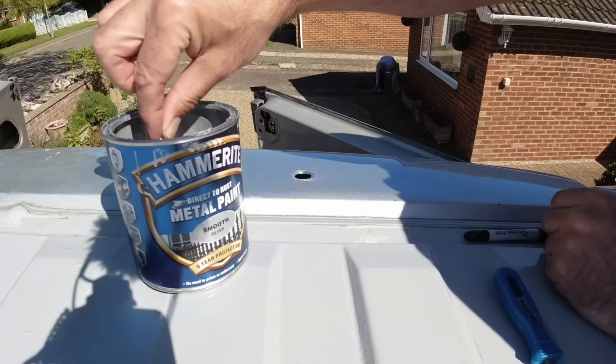Right, let me run through how we're going to connect these two panels together in parallel. I've got all the bits down here that we need. The panels come with a short bit of 4mm cable, couple of feet long. They are marked positive and negative. So we've got these little MC4 Y connectors to connect them both together. So what we need to do is plug both panels into there, and then the one output will go down to our solar controller. So we'll plug one panel into there, and then we'll plug the other panel into there, and then one down to our solar controller.